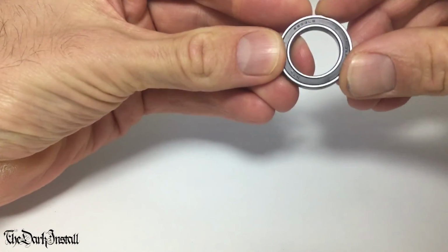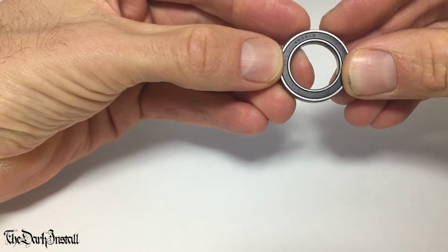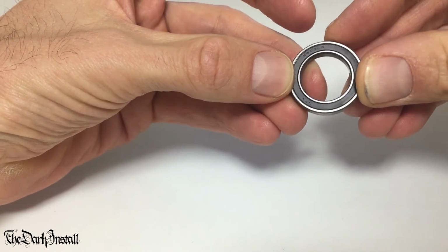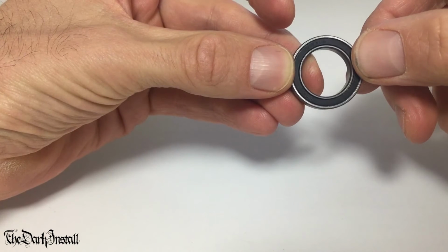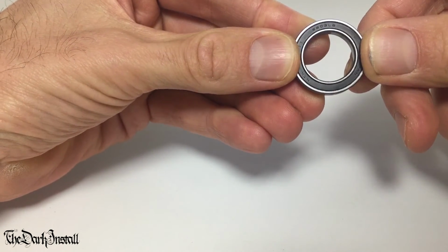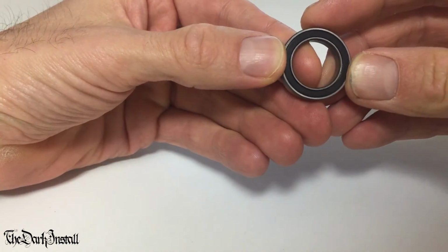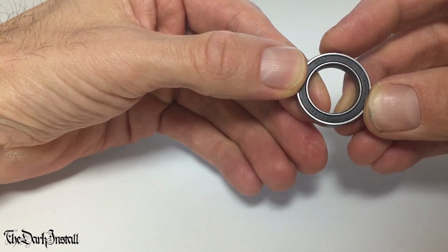Now, the rubber seal in these type of bearings, which are the ones which we use in our bikes, are called LLB non-contact types. Now, what that is, it's a synthetic rubber molded seal that kind of snaps into the gap between the inner and outer race. It's pretty good at stopping dust, but in terms of stopping any water and sweat, it's totally ineffective. Now, you can go on the NTN website or even the SKF website, and you can look at all the data for the seal types. I'll put a link in the description for that if you want to look at that yourself.